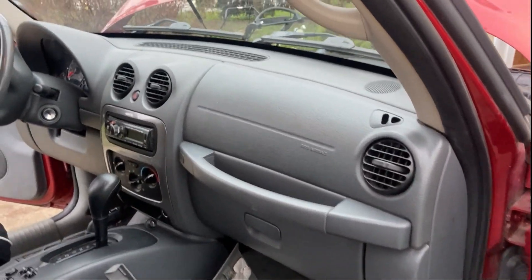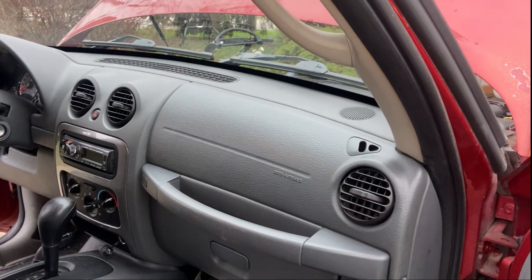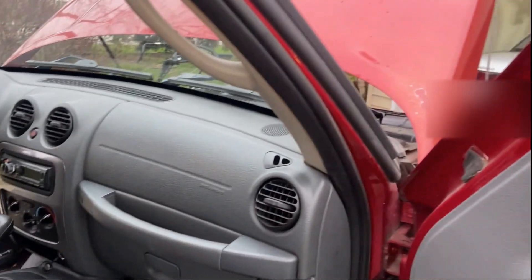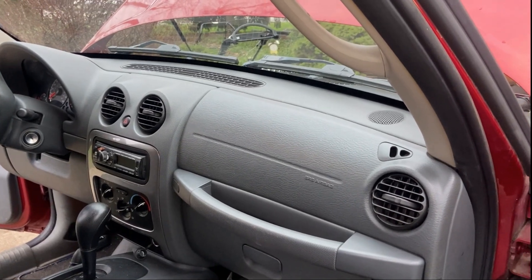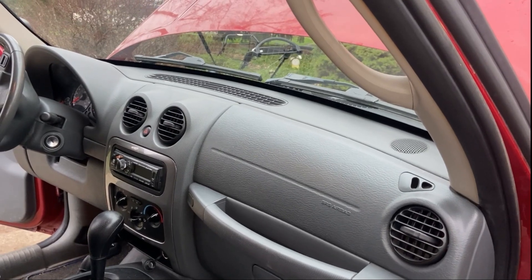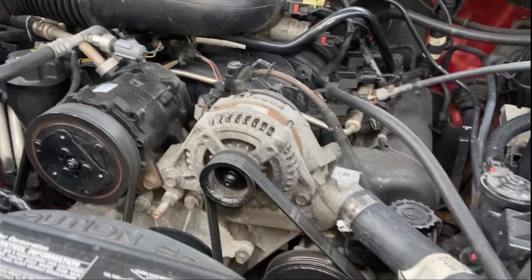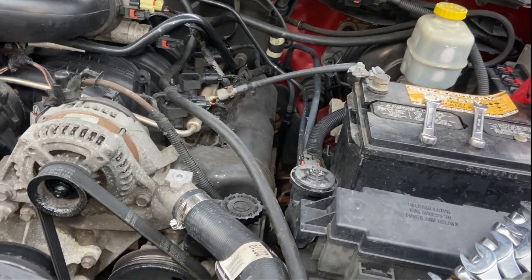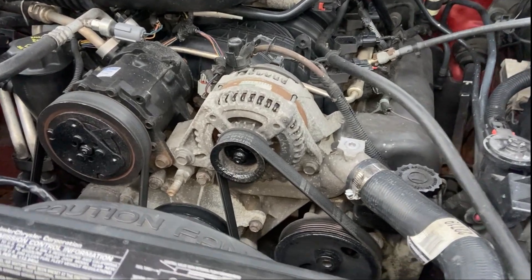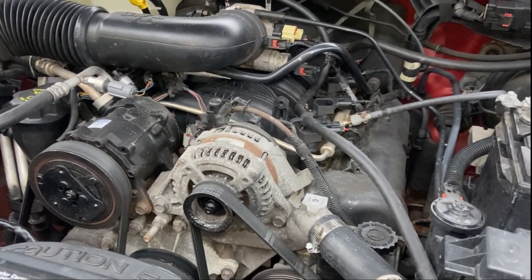I can run the headlights, the high beams, and the indoor fan at full speed and have this heater on — I did a test, and the voltage of the car still stays at 14.1 to 14.7 volts, which means your battery will remain charged. If yours drops down to 13.8 or less, your alternator is having a hard time keeping up. Keep in mind these alternators, when running at lower speed because your car is idling, are not going to produce their full amperage rating. This is a 140-amp replacement alternator, and it's good enough.